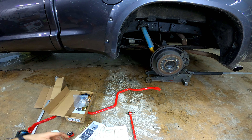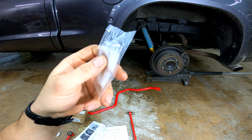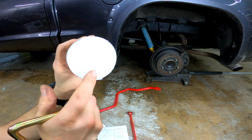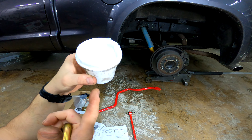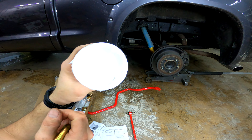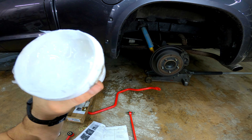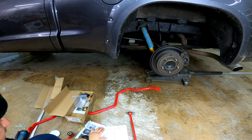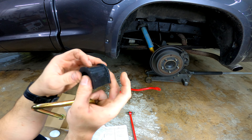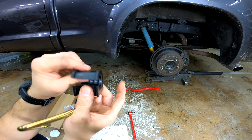Now here's the part with the grease. Toyota supplied this grease — it's pretty thin. What I like to use is this tub of Energy Suspension grease. It's quite a bit thicker and it's really, really good grease for bushings, polyurethane, any performance stuff. Look it up — it's on Amazon. Energy Suspension grease. The grease is going to go on the inside where the bar sits. You don't need grease on the outside because that's just where it's clamped down.